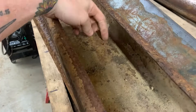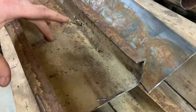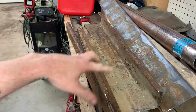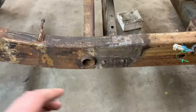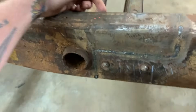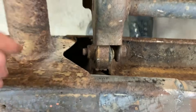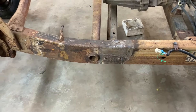Somebody's going to give me a hard time about this being rusty, but it's actually not even flaky rust — it's like factory undercoat or something. It is just fine, and especially with it being that big of a piece, it's going to have lots of surface area. Instead of cutting a hole in my plate to go around this, I'll just cut the rivets off, punch them out, then run a drill bit right through those rivet holes after it's all plated. That way it's welded around and it's got bolts in it — it is not going anywhere.